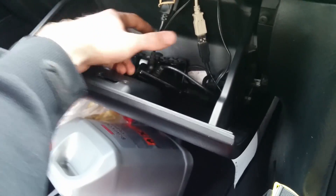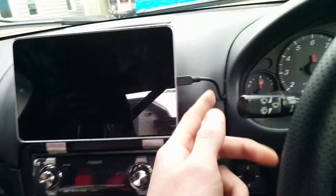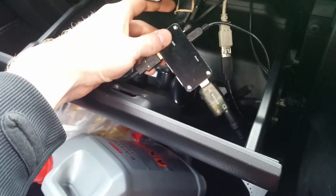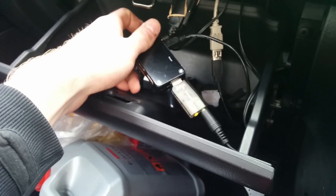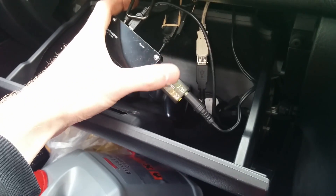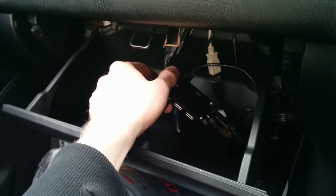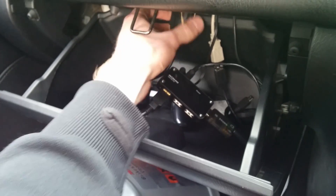In the glove box, I've got an extension running from the Y cable — micro to mini USB — that the new hub uses, with power from the step-down. There's a USB sound card with the auxiliary on. It's just easier to keep this in the glove box so you can pull the auxiliary out or add more ports if you need to, without the need of running a load of extensions.